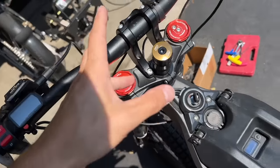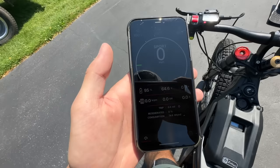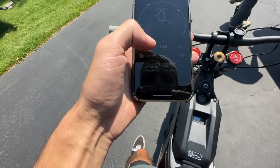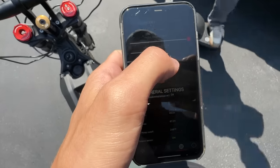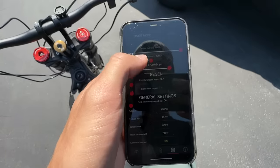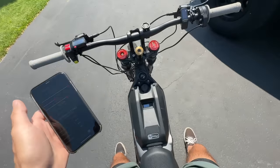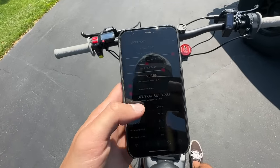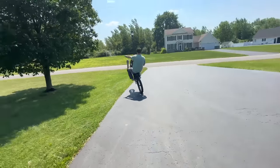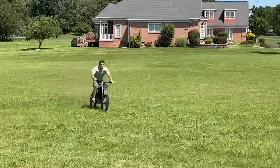Technically you don't have to do anything off the start — you can just turn the bike on and it'll work — but we're gonna download the app, adjust some settings, and bypass the battery to get more power. On the Torp app you can see the speed, adjust all the levels and settings you'd need. We maxed out everything: motor current 500 amps basically. The battery current gives you the top speed; the motor current gives you the torque. Fully maxed out — it might get 10 miles an hour faster and hit a lot harder.